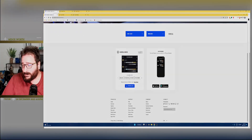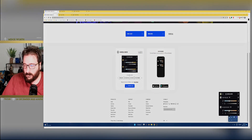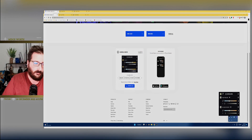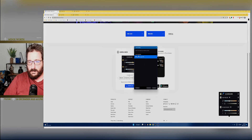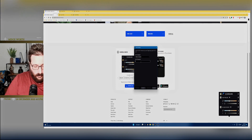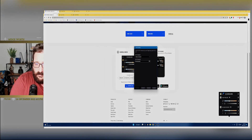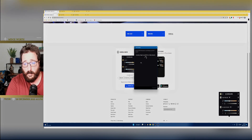It will appear on your taskbar at the bottom with this icon. Click on it and it will give you all the lights. I have more than one light. If you just click on the plus, search in accessories — click on the plus, Elgato Key Light, connect. Then you put in your password for your Wi-Fi. Make sure that is 2.4 gigahertz Wi-Fi because otherwise it won't work.